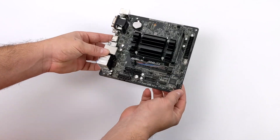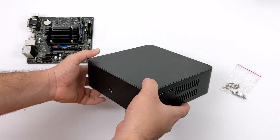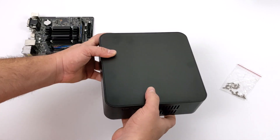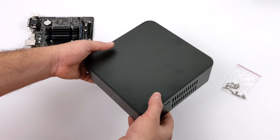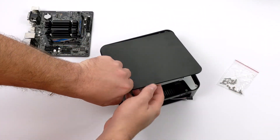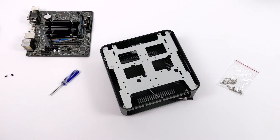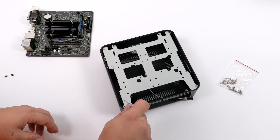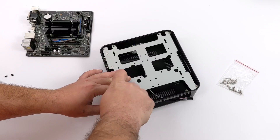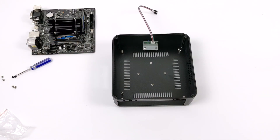It's time to put the motherboard inside of the case. With this RGeek case there's really not much to it. We have our power button on the front, ventilation on both sides, and two extra USB 3.0 ports. This was a cheaper case coming in at $29.99, made out of aluminum, 3.5 millimeters thick — I really do think it was worth it. We have the hard drive bracket on top, which can mount two 2.5 inch SSDs or one 2.5 and one 3.5 full size. Once we remove that bracketing system, we have a lot of room in this case for a Mini-ITX build.